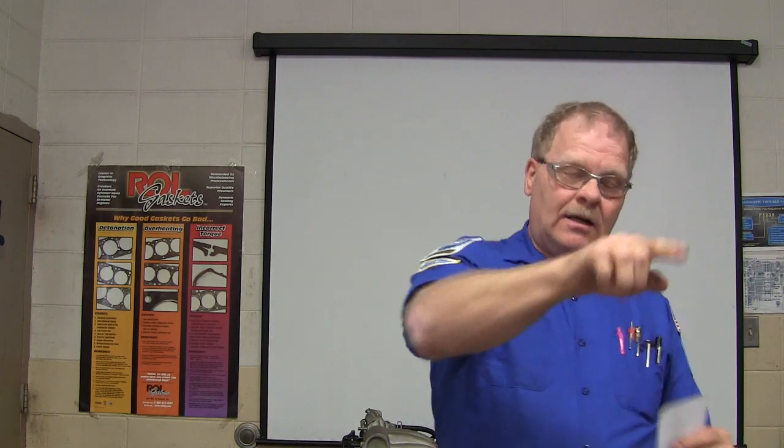What are the three harmful exhaust gases? You told me crank sensor. Oh, okay, never mind. I did say crank sensor. If I'm checking for spark and I don't have spark, I'm gonna listen for fuel injector pulse. If I don't hear fuel injector pulse, I'm going after the crank sensor. You told me cam. I did not even tell you cam. You even did a worksheet on it. You are making that up.